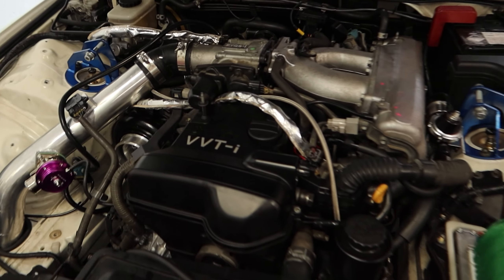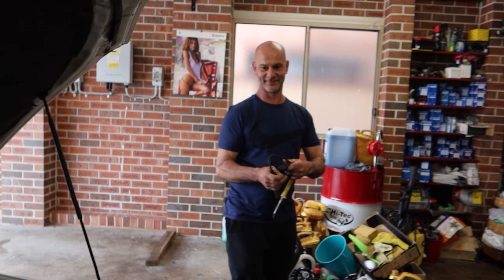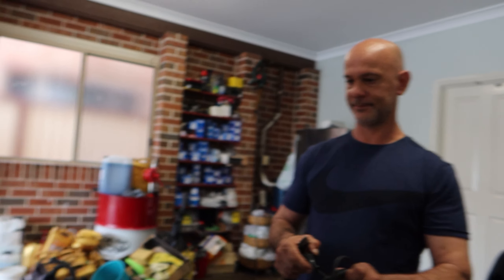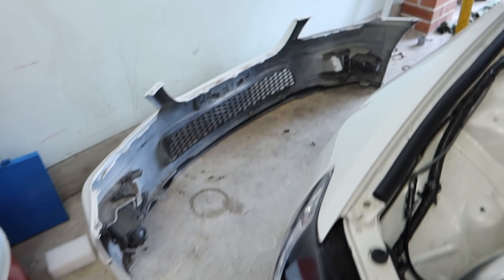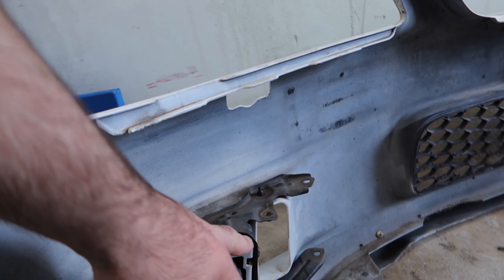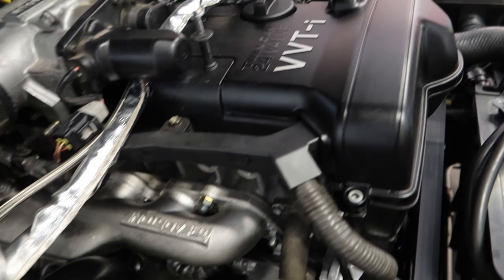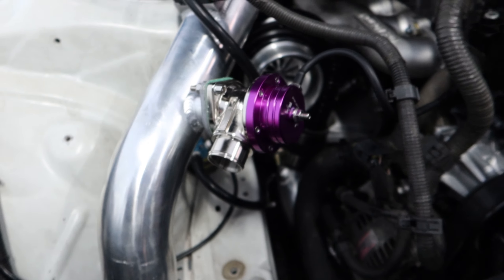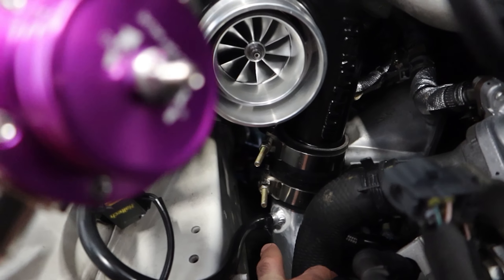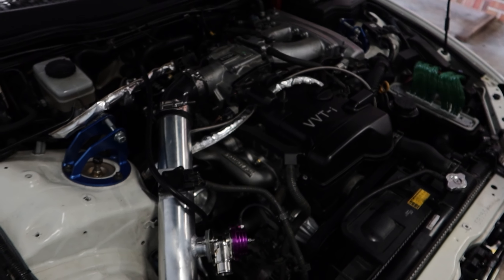As you saw in the time-lapse, we've fitted up all the rest of the hoses. The boys painted the intercooler black — it looks very good and stealthy. We've also blocked off the wiper motor for the headlights so we can fit the IS 300 bumper without the motors in the way. The blow-off valve is plumbed up to vacuum on the intake manifold, the wastegate is all plumbed for low boost for now so we can tune it, and we've got the three-port boost controller done. We also got that bung welded onto the pipe coming off the turbo. Pretty much just the exhaust now and then straight to the tune — hoping for some big power!